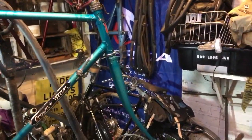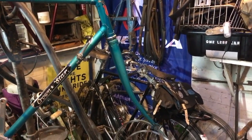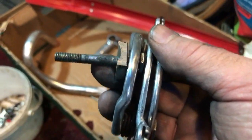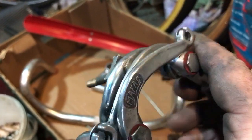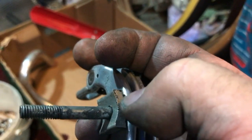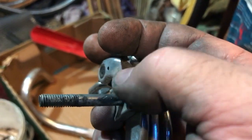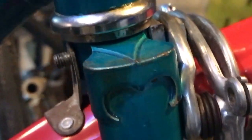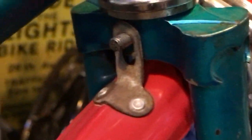That's all the same at the front now — I'm just going to hang the brake, hang the mudguard, pop the wheel in, same as before. I'll just show you that the front brake has a longer mounting bolt, and if you remember my video on centre pull brakes, you squeeze the brake to drop the bolt in. The washer on the front brake is a shallow curve which matches the curve of the crown of the fork, so it sits in there nicely.